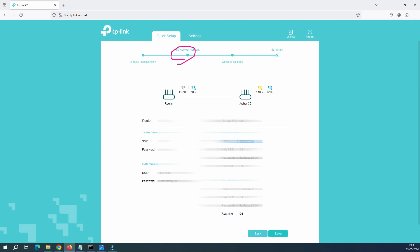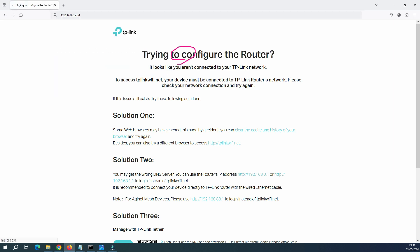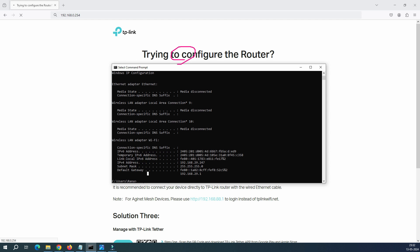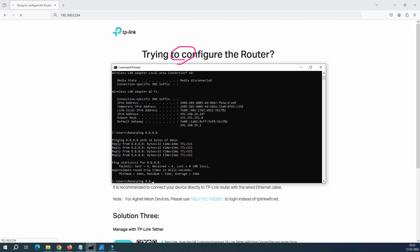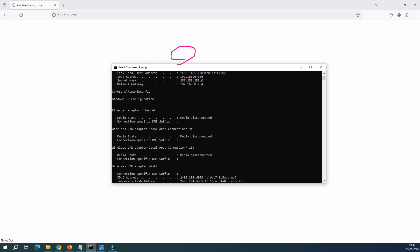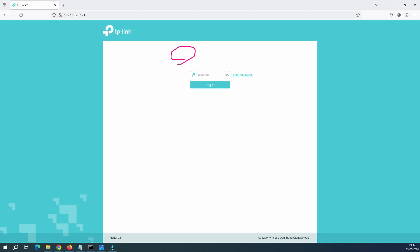Click Save and we got disconnected. After reconnecting to Homeland-01 or Homeland-02, I run ipconfig and I'm now getting an IP from the main router. When I ping 8.8.8.8 I can reach the internet, and pinging google.com it's working fine. That's how we've enabled the Wi-Fi extender on the TP-Link Archer C5 router. Now I'll show you the advanced mode configuration.